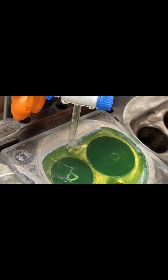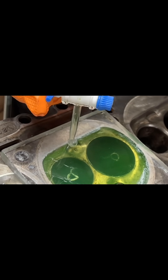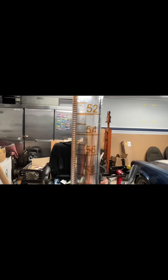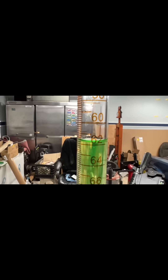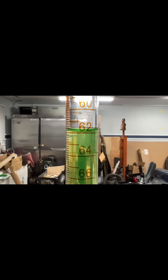Now summon all your inner precision because we're going to top off the rest of this fluid and get it to stop before it overflows right there. Perfect. Now we can read the scale and see how much liquid was transferred over to the chamber — and we can see that we have a 62cc combustion chamber.